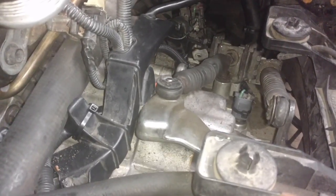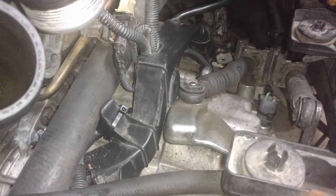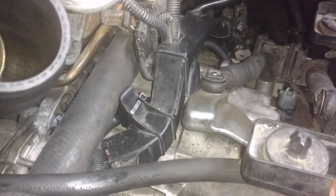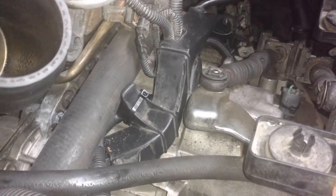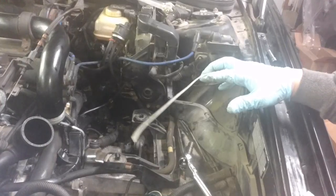Right now the linkage is rubbing against the plastic on this auto wire loom. So that needs to be moved or secured some kind of way. I probably need to change it with one from a manual gearbox. So I'm going to work on trying to get this secured over at least a half inch and go from there. Zip tie thing was probably 3 feet long, and I wrapped it around the wire loom, got it quarter inch clearance for my shifter stuff, ran it under this bracket here that holds my crank sensor plug. I ran it under the coolant hose, and it doesn't seem to be touching the coolant hose on that side. So we're good to go. Got that off of there. Wow, that took a long time to come in focus.